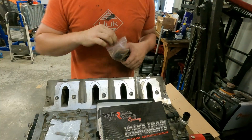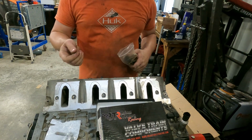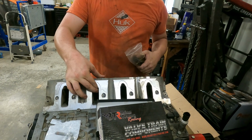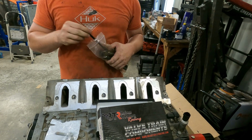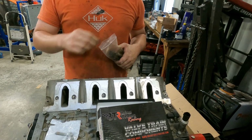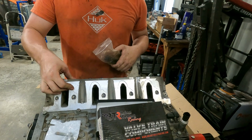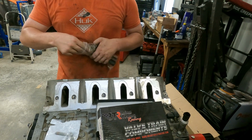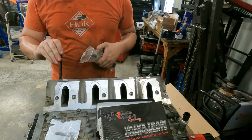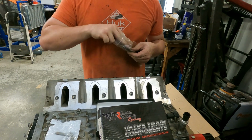70. All right, now we're installing our brand new push rods. I just push in, and the way you know you're in the hole, push down on it, and the lifter will click. And that tells you that you're doing your job. As long as the lifter pops, you're good. There you go. I'll do that other side real quick.